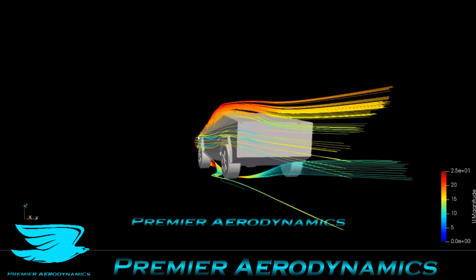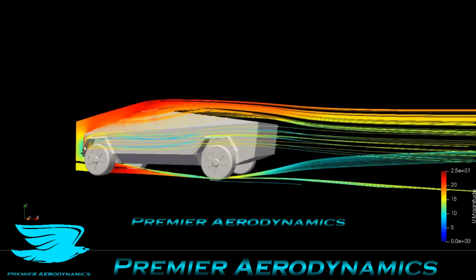Also, there are some streamlines that come around the edge here. These streamlines coming around the front left bumper first go on the wheel housing, which is not great, but that happens with most cars anyway. And then the streamlines coming around the edge here — they separate, and that's not great either.